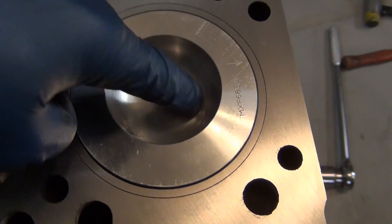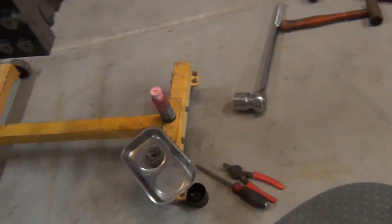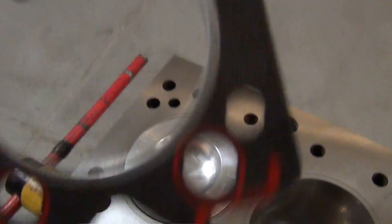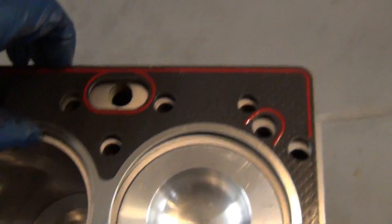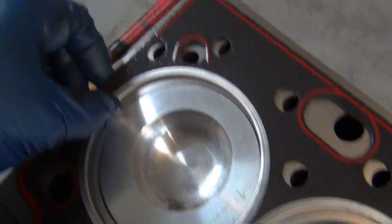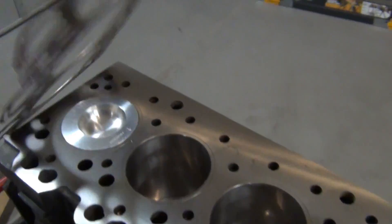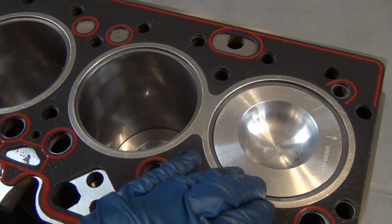The piston cavity is toward the camshaft side. When you go to put the head gasket on, it's incredibly symmetrical with one exception — these two holes here versus these two holes there. You identify where the oval or pill-shaped hole is, lay your gasket in place, and these holes line up here, these line up there, and all the rocker arm holes are in place. If you flip it the other way, it blocks off one of the holes — so it definitely goes this way. Watch for that.